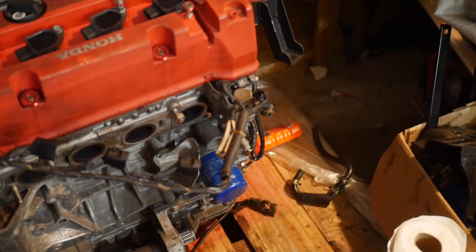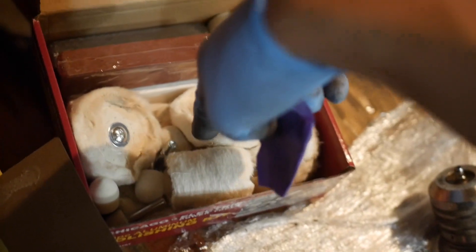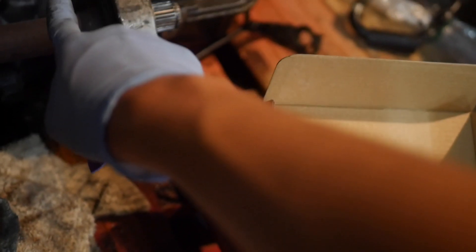Since I'm waiting on a lot of parts, I'm going to polish the block here — this is the back of the motor where I have an open rear end. I have sandpaper from 180 all the way up to 1400. Starting with 180 — you don't need to go super coarse or you'll just end up making deep scratches. Once it gets to a dull shine, I use some wool and smaller bits from Harbor Freight for about 20 bucks, attached to a drill to get into the small crevices.